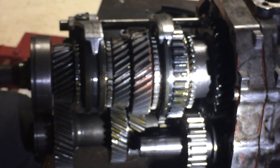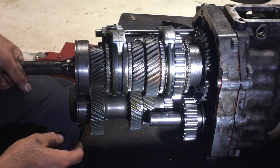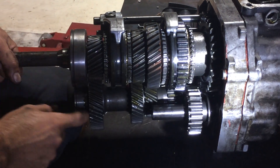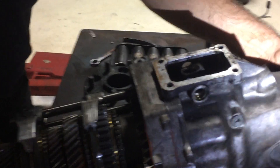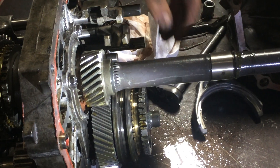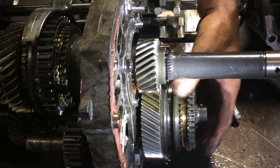Okay, so input shaft, first gear, second gear, third gear, direct drive, and then back here is our fifth gear — overdrive. It's hidden way in the back. On overdrive, the output actually spins faster than the input — that's fifth gear right here.